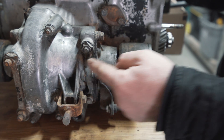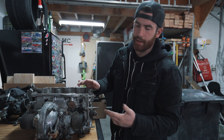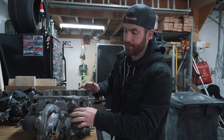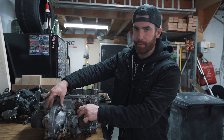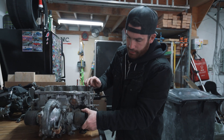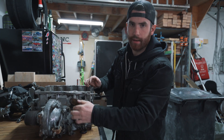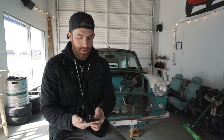So if that is the case, you're going to need to take these off, press and ream new brass bushings inside here, and then replace it — keeping in mind that it's usually easier done with the engine out, though it is possible with it still in. You will need to shim the diff, so if you are taking them apart, be aware there are shims on the backside and you need to make sure the preload on the diff bearings is done properly. That's taken care of with these side covers and the shims that ride underneath them. So take a look — if they go up and down like this, you most likely need to replace the bushing and then the seal. If they're nice and tight and it's still leaking, then the seal alone will fix that.